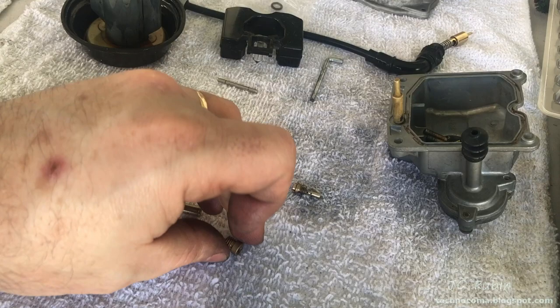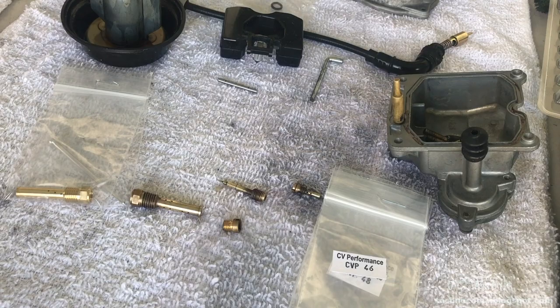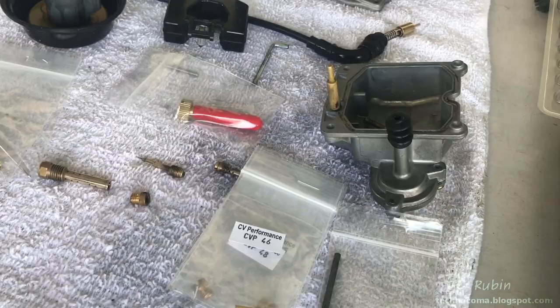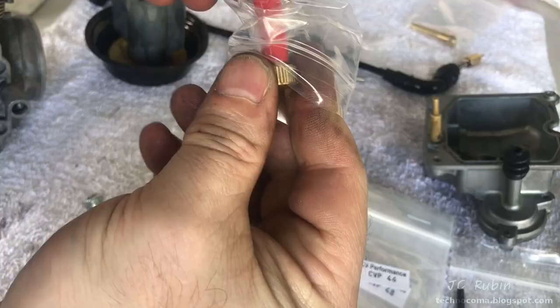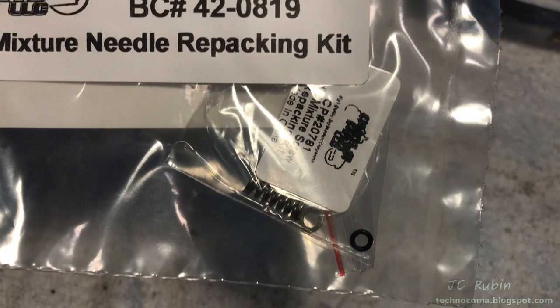Visual inspection from the side and then looking through confirms everything is clean — this jet's easy to check for obstruction at this size. I don't want to bring any confusion into this rebuild, so I'm going to lay down the new parts alongside the old parts and call out the changes as I do it. This drill bit is used if the pilot is capped — ours isn't so we won't need it. Here are all the remaining pieces. This is the new idle adjustment screw, which allows turning with your finger instead of a screwdriver. I'll place a spring over it.